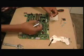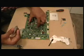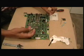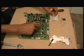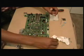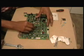Now get the CPU chip. We're going to take a dab of thermal paste and place it on the big chip and the little chip, just enough to cover the surface. Have a little extra — you never want to put too much on it.